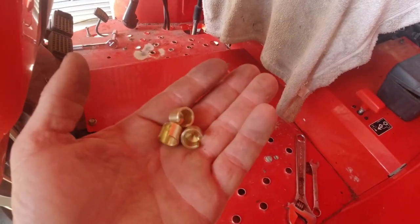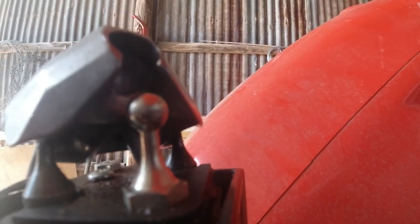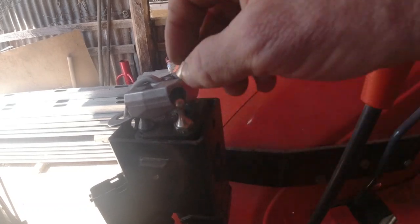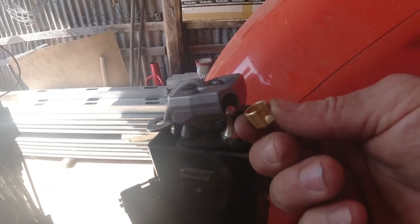I'm not going to let the other two break down - I thought I'd replace all three while I've got it apart. But after playing around here for 20 minutes, it appears you can't replace them all. You'll have to replace them as they break off, because I've just noticed that nylon ball in there is actually pushed on or molded onto the knob - it doesn't just slide off and on like the new brass section does. So it looks like I've got to put this new brass section on and then replace the other two as they break.